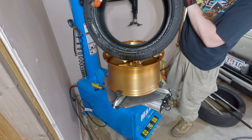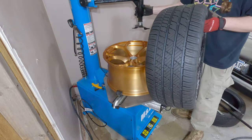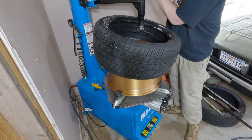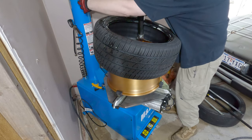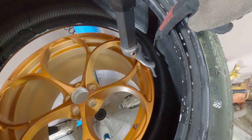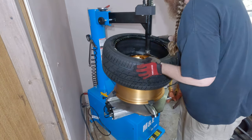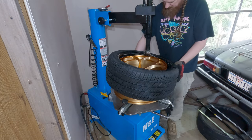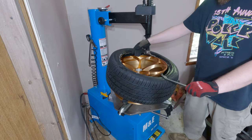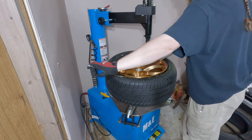Rub tire lube all over the tire — whatever they put in this stuff it smells kind of nice. Pay attention to which side is the outside and inside. This wheel is almost too tall for the machine; I have to slip the tire up into the duck and bring the duck around, get the tire partially pushed on, then lock the duck down on the rim. Set the duck so it's just barely floating off the rim. Position the edge of the tire so it goes under the duck head. I wish I had a helper arm on this machine — I kind of cheaped out on that one.